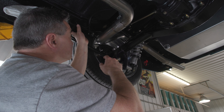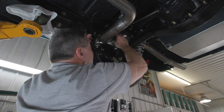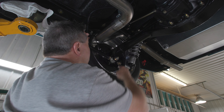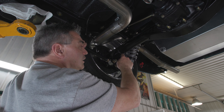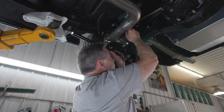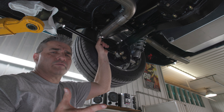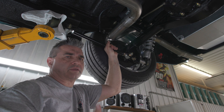This is a pretty snug fit — you'll have to use a dead blow hammer and tap them into place. We supply Grade 8 bolts with our kit that you'll have to drill and bolt these up. Some people will use a stitch weld along with the bolts, though I think that's more of a comfort factor than it really is for strength.